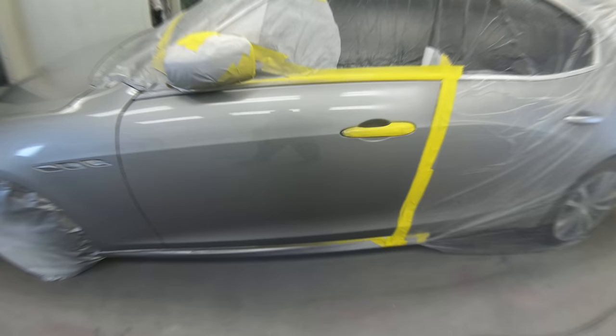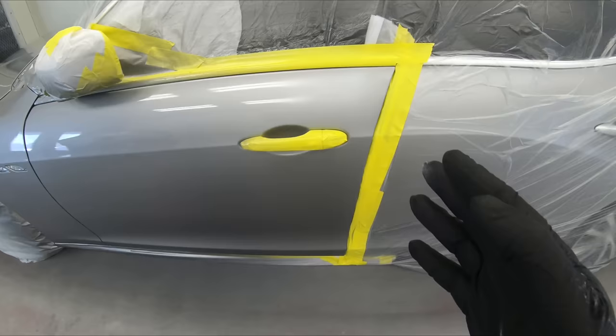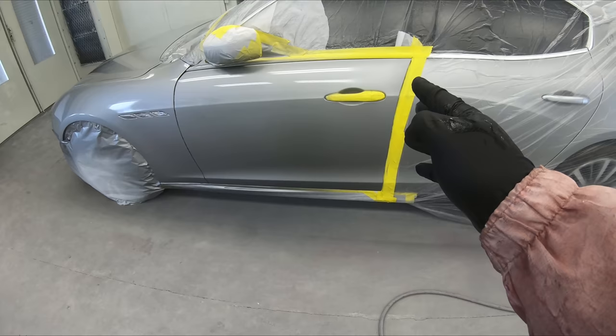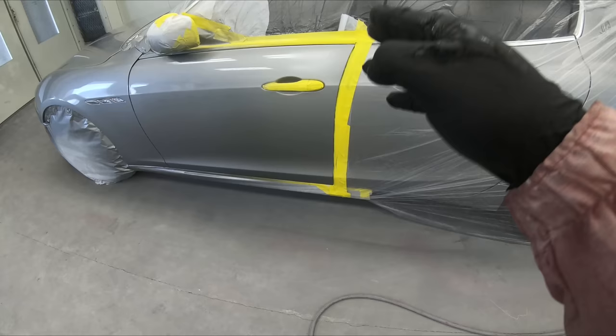And after that first coat of clear, you can see how Pedro stopped right here, okay? There's no clear here. So one coat of clear on the edges is enough. It's already got the UV resistance, the original clear there. And if you put too many coats or pile them up on the edge, that sometimes will appear darker than the rear door, even if there's not color there.